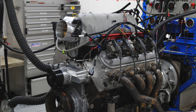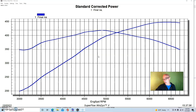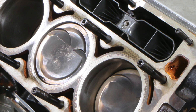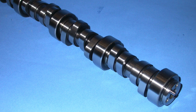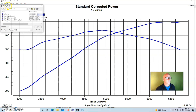Now let's take a look at a slightly larger 5.3 liter LS. After the '03 Cobra modular motor, it's time to look at the LS engine family and another 900-plus horsepower combination. This one actually belonged to David Freiburger way back. It featured forged internals — forged rods and forged dish pistons — giving a lower-than-factory static compression ratio. It also had Trick Flow heads and a Summit Pro LS turbo camshaft. We ran it with a FAST intake manifold, long tube headers, and a Holley HP management system. The naturally aspirated 5.3 made 448 horsepower and 418 foot-pounds of torque.